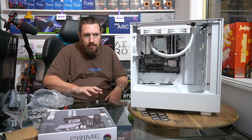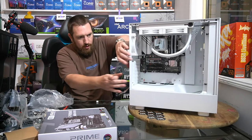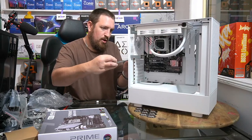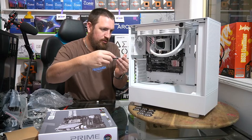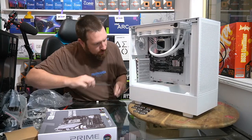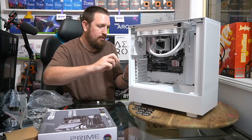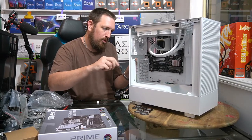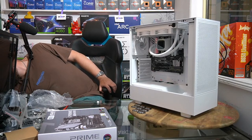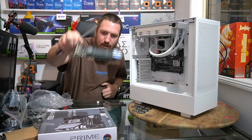Okay, graphics card time. So with this board, we're using slots 1 and 2 for our graphics card. You might notice that there's what looks like 3 slots that are the same size. One's in silver and the others are just black. So even though they look the same length, they're not actually the same length. Those 2 bottom ones are what they call X1 slots. So they're not actually connected all the way along. They're only connected just at the start of the slot. Tiny, right?